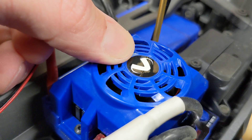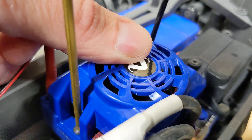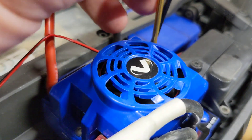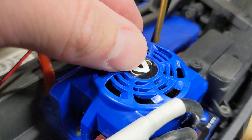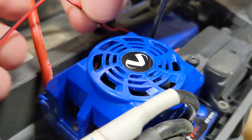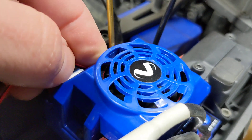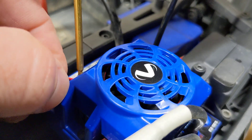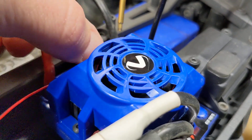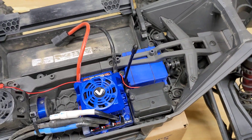You don't ever want to over-torque anything, especially plastic or aluminum. Snug is fine. I'm not going to bust my torque wrench out on this, but if I'm given torque specs I typically will. You can always tighten it a little more, but if you over-tighten it you usually only get one chance and then it's stripped — and that's just not fun. I'm just gently pushing these motor fan wires back down. Now those are routed.